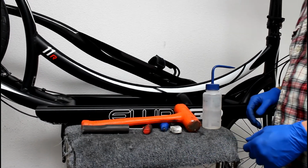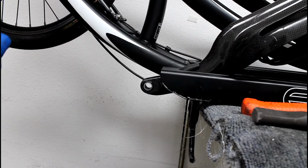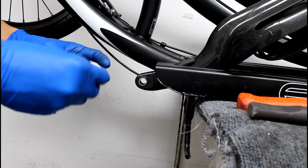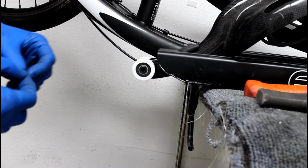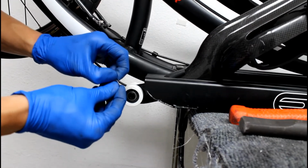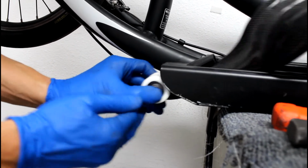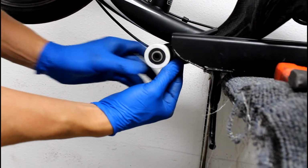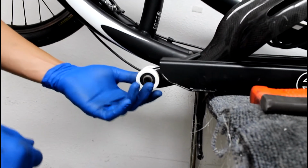Okay, and then you can go ahead and reinstall your drive arm. Alright, so just reversing the process of removing the load wheels. Just want to get them on the axle here. Just install that into the drive arm. Now you've got to put the retaining ring back on. Just find one edge of it and try to seat that around the groove in the load wheel axle, and just slide it into position. It should pop on. It'll probably take you a few times the first time until you get used to it, but then you get your technique down. And then yeah, so that's installed.